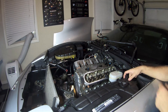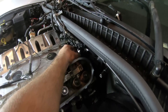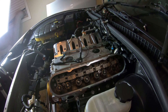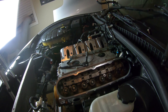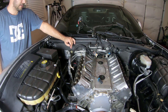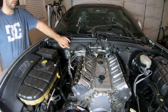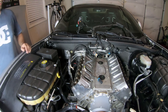To remove a couple of the head bolts I also loosened this one back here — I'll tighten it down just in case. The passenger side head bolts are in for the first round — now it's time to actually torque them down to 22 foot-pounds. Second pass is complete, all ten of these are at 90 degrees. Now it's time for the third pass: the eight long bolts get an additional 90 degrees, and the two short bolts — nine and ten — get an additional 50 degrees. Then start working on the top bolts, torquing those down to 22 foot-pounds.